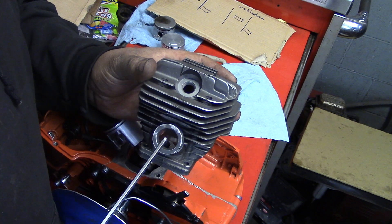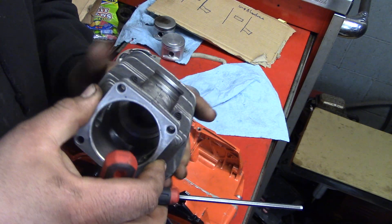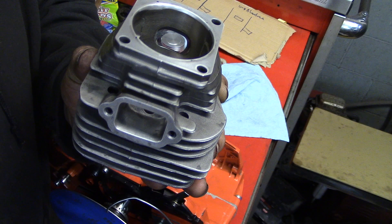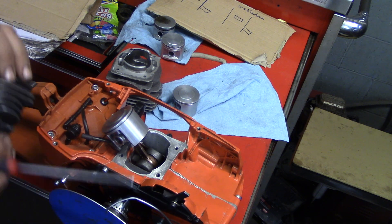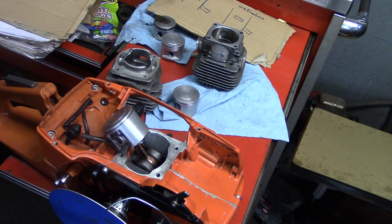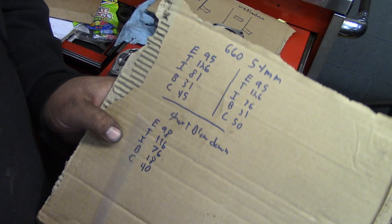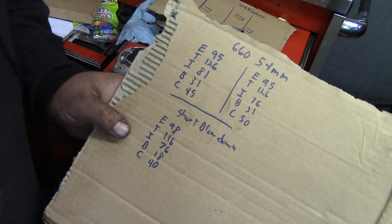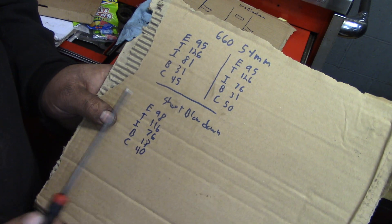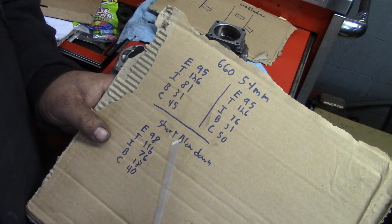I made sure this was all filled in nice and matched to your boot. Man, the thing ran really good — powerful, snappy, strong. Unfortunately, my plating chipped and I had to raise my transfers to fix it. This is when I learned about short blowdown. I had to raise it to 116 degrees on my upper transfers, which lost me 10 degrees of case compression — went down to 40 instead of 50.